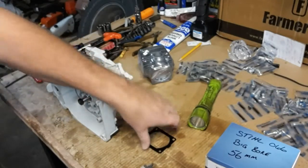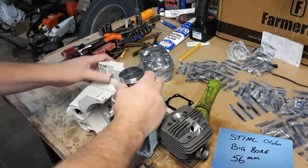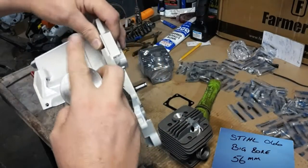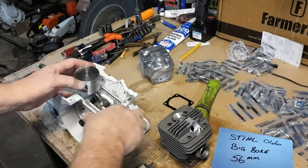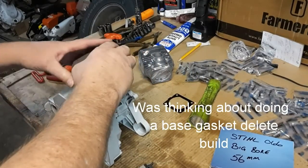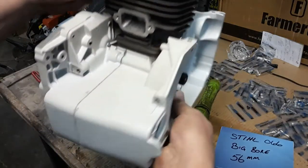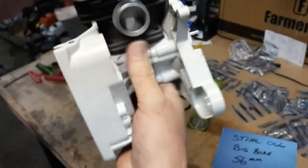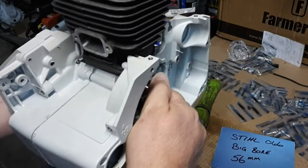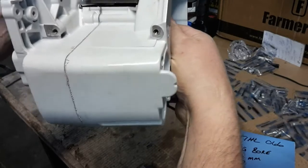Anyway, get the piston on it and get ready to set the cylinder down. The arrow is pointing toward the exhaust side, and this here is the intake side. What I was doing was checking squish — finding out how much squish I had on it. So I basically just set it down on there. Looks like it seats down, looks like it's going to be made up. I was debating on whether to do a no-gasket base build. So I went ahead and turned it over just for giggles — did you hear that? That's the piston hitting the top of the cylinder.